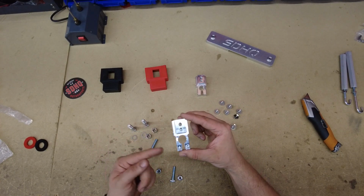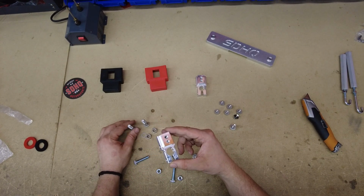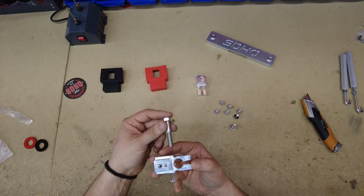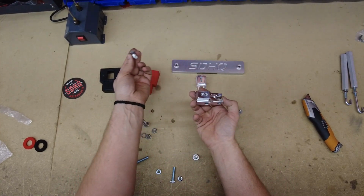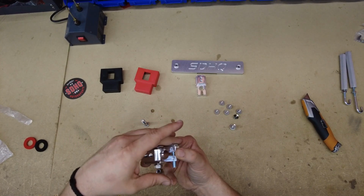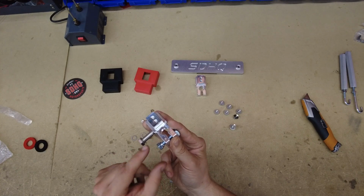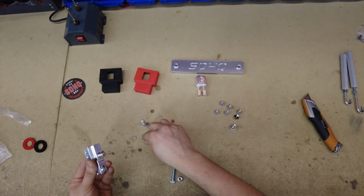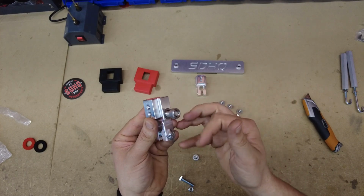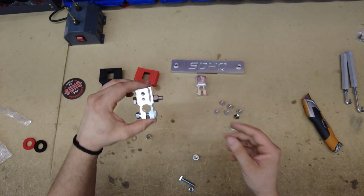I like to do these main cross through bolts the same way. So I essentially do them in such a way that when the vehicle is put all the way together on the positive side, you're not trying to pull this long bolt out to where it can contact your battery tie down and cause it to arc out, right? So we want it to go this way. Whereas the other side never comes out because that's the clamping bolt. So we put it the opposite way. So since it never comes out, we'll never risk it hitting that battery tie down, especially when we're pre-assembling it like this. So we're gonna take a washer, throw it on this side, take the nut, throw it on too. And now that's what I would consider a pre-assembled terminal for getting it installed in the vehicle.